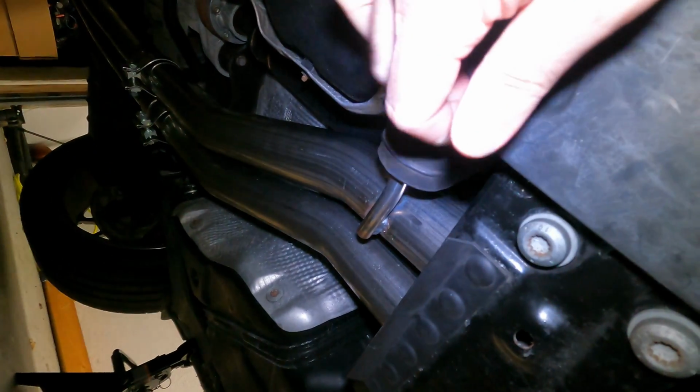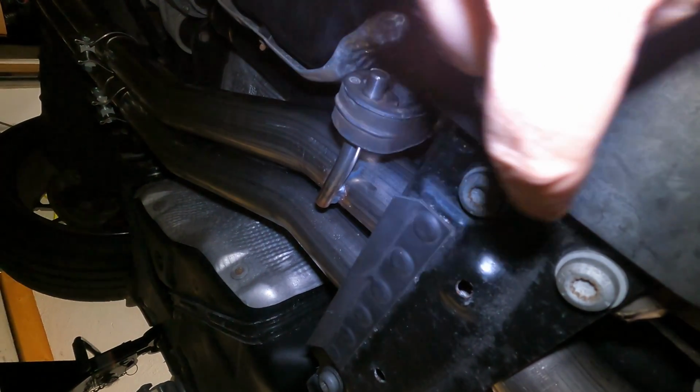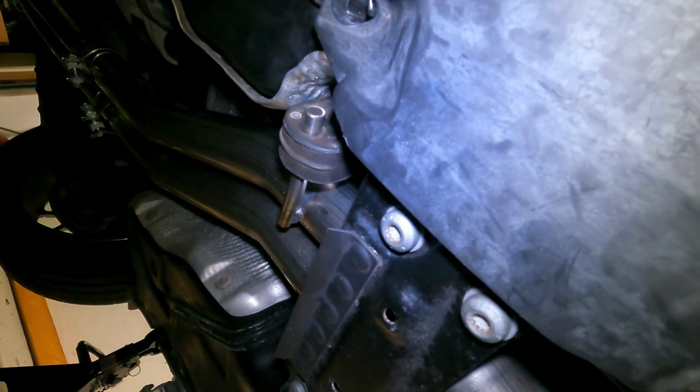I'm gonna work on these next, and I'll keep moving back. I've got 6 more clamps to go. We've got the middle brace installed. Pro tip, pull out the 10 mil that's here, and that way you get a little bit more room in here because there's spacers that are included, and you gotta have enough room to install them against the body. I was fighting with this for a while before I realized let's just go ahead and loosen it, and then it went on no problem.